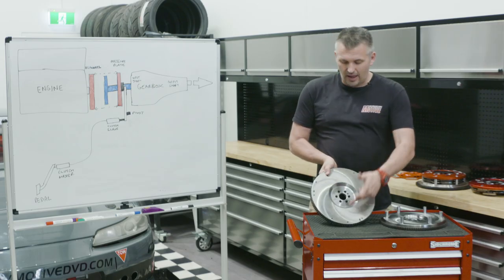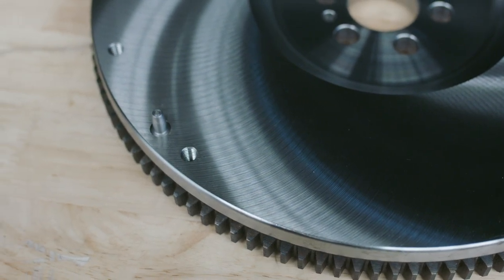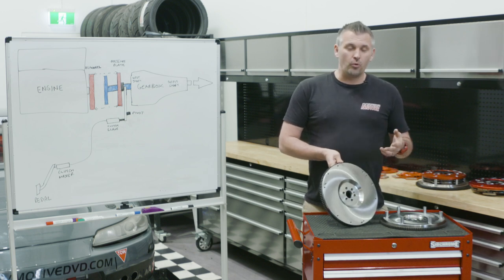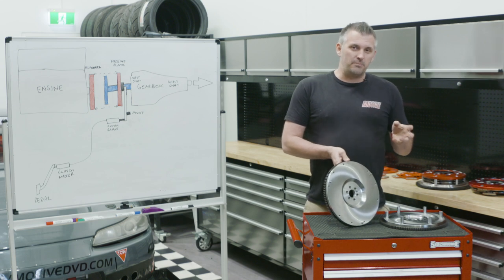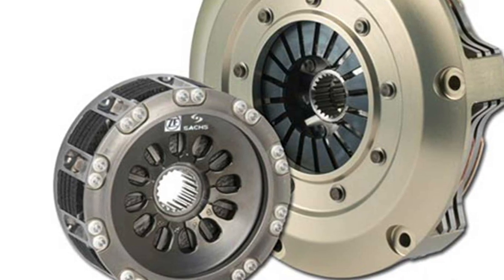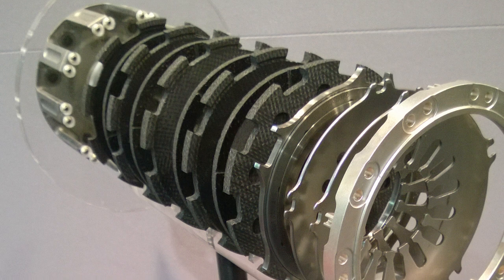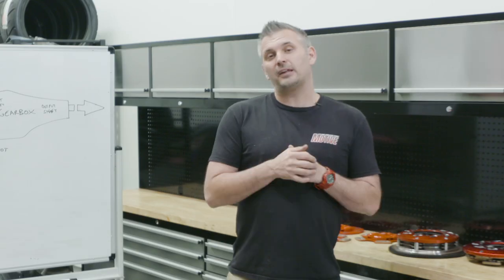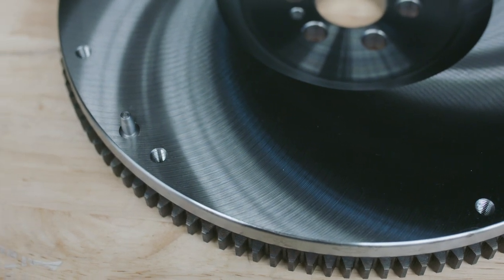The last consideration with a flywheel is the diameter — how big it is. Obviously the bigger it is, the heavier it's going to be. However, if you make it a larger diameter but make it thinner or use a better material so that it's lighter, sometimes that can work in your favor, because if you can put bigger clutch plates on it overall, you can actually have less clamping force but have more torque holding capacity. That's not really important in most cars because you can't go any bigger than factory, but you can go smaller. Race cars can have a flywheel that's half the size of factory because all of their clutch plates and pressure plates are tiny, and they might spread it over six or seven plates. You've also got to worry about the ring gear which is what the starter motor is attached to, and you're basically confined by the size of that.